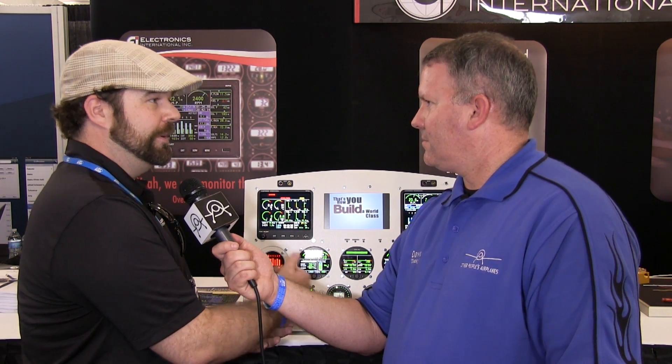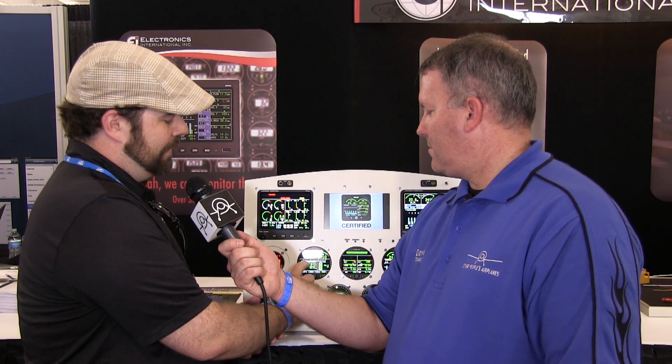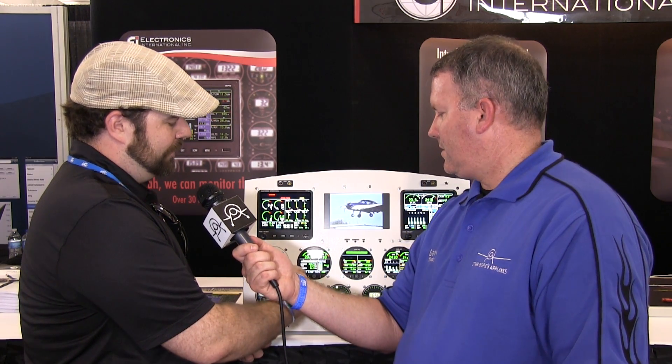It sees your destination from the GPS, determines how far that destination is, and then gives you a reserve — so you can see your fuel left over at your reserve. And it will alert you if you don't have enough. We have estimated quantities on board, quantities remaining, quantities to get to your destination and reserve, times on board to your destination and in reserve, estimated reserves, and your distance, time, and quantity, as well as all your fuel used.